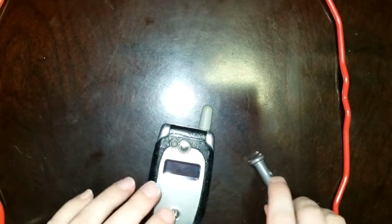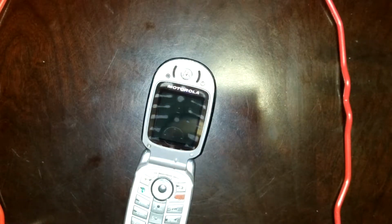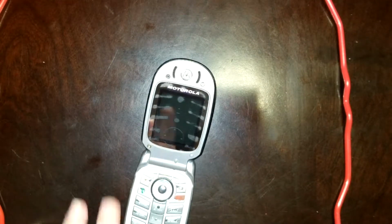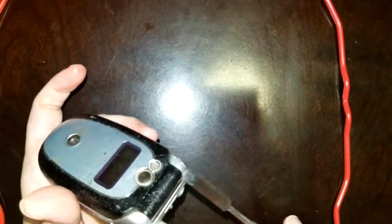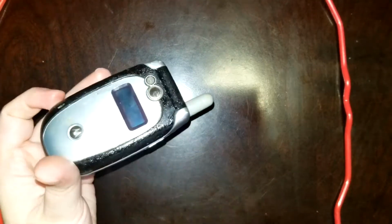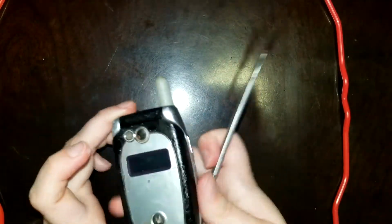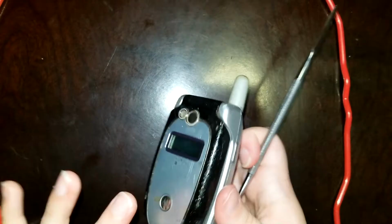Now that all the screws are loosened, we can start trying to remove this upper shell. And to do that, let's use a metal spudger. Now, the things to be mindful of here are at the top of this, near the hinge, we don't want to risk severing the main ribbon cable that connects the screen and the motherboard. We don't want to pry too deep around the sides either due to the screens.